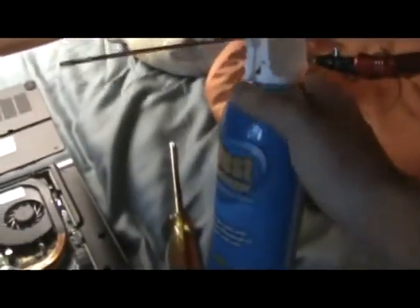The biggest thing you don't want to do with this can of compressed air, I know this happens with Dust Destroyer, I don't know about any other companies, but if you flip it over and shoot, you'll see that stuff come out. That is the liquid form. Not only is that very bad for your computer, it can give you frostbite. I can already feel the can getting a little cold.